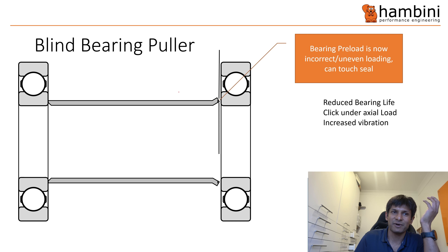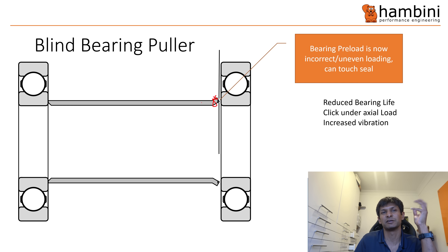The net result is a chewed or messed-up end, and bearing clearances are typically 15 to 20 microns — quite small. If there is now a slightly larger gap than there was, the bearing life will be diminished because it's been clamped up and moved further than it's supposed to. If you flare it too much you can end up touching the seal, and you could possibly end up with more lateral flex — so as you turn the bike, the wheel deflects more.